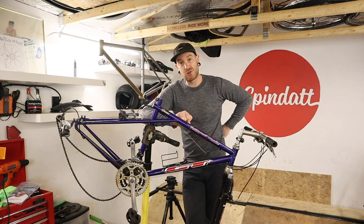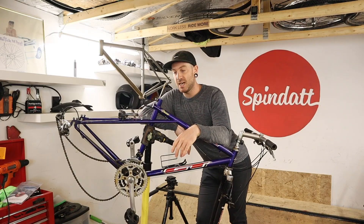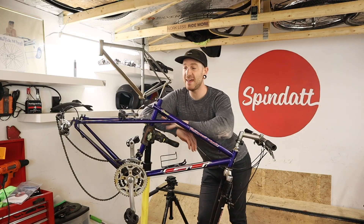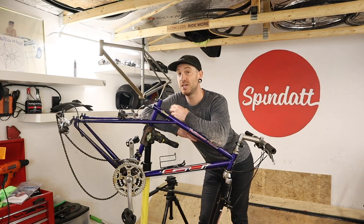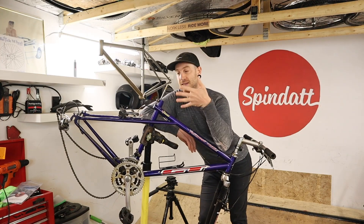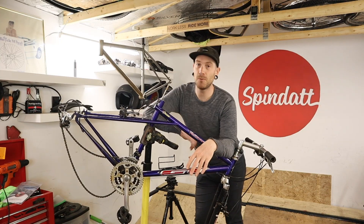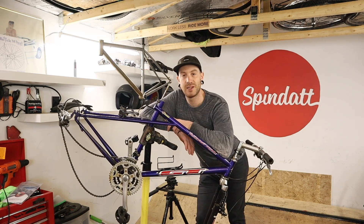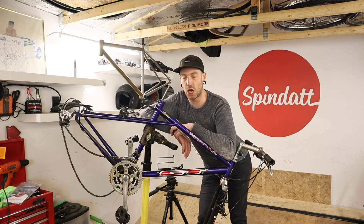It's really stuck. I tried drilling a hole through it to get it to break free — no dice. Tried putting a pipe wrench on it — no dice. Tried cutting it, slotting it, and breaking it away that way — no dice. So I shoved a couple of screwdrivers into it hoping it would eventually break the broken bits of aluminum seat post away from the frame so I could take it out piece by piece. What it ended up doing instead was piercing a hole through the seat tube of the frame. I deemed it unrepairable, unfixable, and garbage, so I threw it to the side.